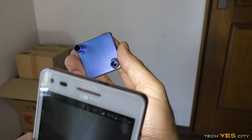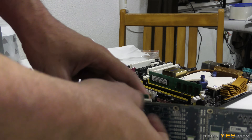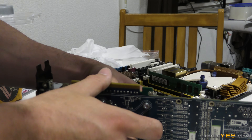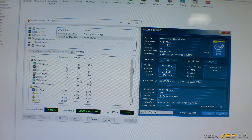That's pretty much pathetic for a water cooling block. The water cooling blocks do connect properly now to the GPU die and the CPU, it's just that the temps are still a little bit high. I also have to call this a $60 loop now because I had to spend extra money on materials like bolts, wood ply, and sandpaper. The concept does work, though honestly it was just a lot of fun and a big learning process. When it comes to water cooling, you just can't skimp on some of those parts unless you want really mediocre performance. Those CPU blocks, even though I sanded them back, are still garbage. That pump is still a little bit weak. And that clear tubing from eBay — be very careful with that stuff, some of it was straight-up junk. However, the radiator, the reservoir, and the car hosing were pretty good, and I can recommend those.